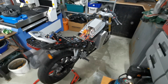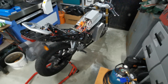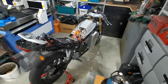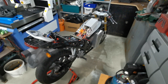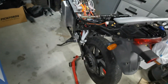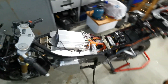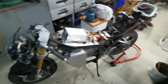I just took it for a ride up and down the driveway — definitely doing the business with the new motor. I was basically maxing out the current at about 130 amps, which is about what I can do with the batteries I've currently got set up. It definitely has substantially more torque than the first generation, which would be expected — it's probably doing about twice as much power into the motor. Everything's working pretty much as expected, with the small sprockets on the motor controller. Obviously there was no actual heat in any of the electronics — everything was doing what I was expecting.